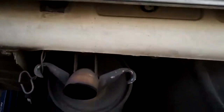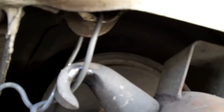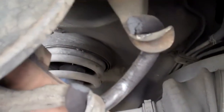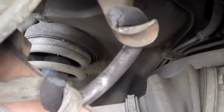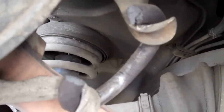The next thing we're going to recommend are the muffler donuts. The muffler donuts are missing on this exhaust, and it looks like somebody put some wire here to keep the exhaust from falling down. You really should have some muffler donuts holding this exhaust up. They're apparently all broken except for one here — this is the remaining muffler donut; this is what it would look like if it were holding the exhaust up. All that's holding this exhaust system up is that one wire, so I recommend replacing the missing muffler donuts.